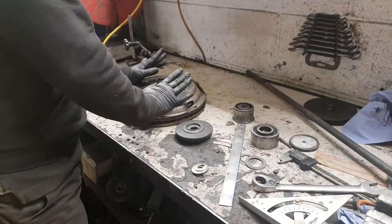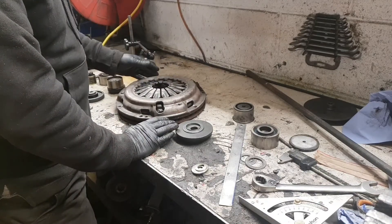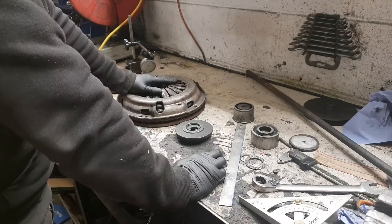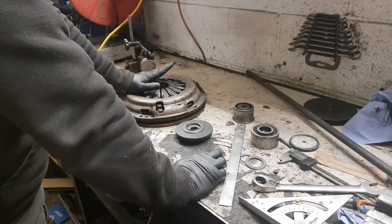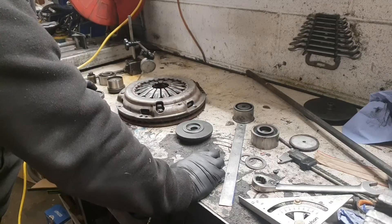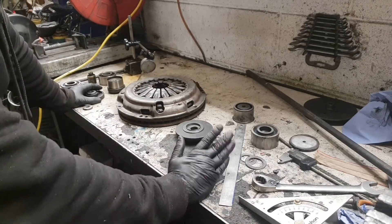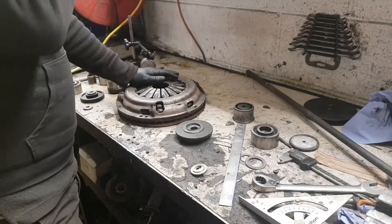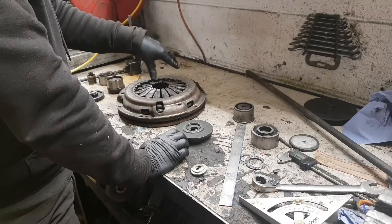Today I'm having a problem with a faulty clutch. This is the one that came out just through normal wear and tear — the friction plate was worn, just normal age-related problems. But when the new one went in, the pedal has been soft and it's not the hydraulic system. I knew it wasn't, but I've replaced the master and slave cylinder, checked the flexi, everything. I'm certain the clutch cover in the car now is soft for some reason and it's not releasing properly.